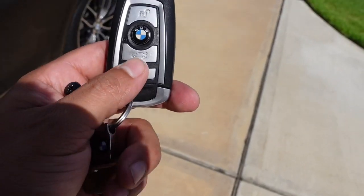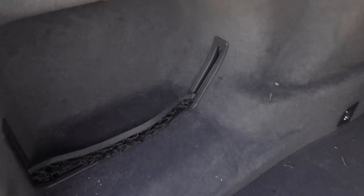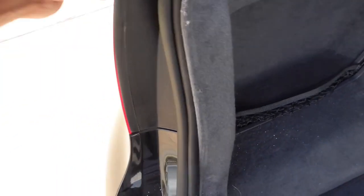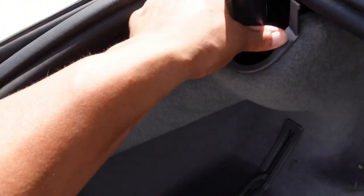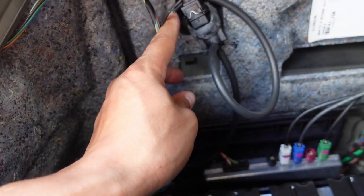Let me show you guys what these little valves look like. Open the trunk — on this BMW 750 we're going to go into the driver's side area over here and pop this weather seal up a little bit to give a little more slack. Then carefully pull this panel down, and there is the actuator. You can see the vacuum lines going into it.